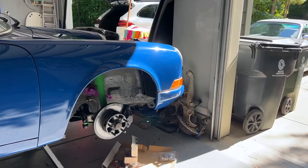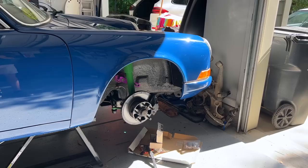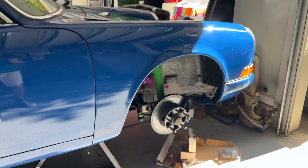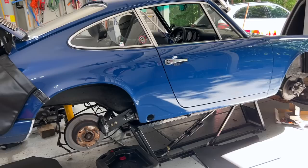It's got a small fan on it, which will help — though it doesn't have maybe the best airflow because the battery box is in the way. But that cooler with a fan, plus we're going to be running the elephant finned oil lines, and the fact that it still has an engine mounted oil cooler — it'll be overkill with plenty of cooling. We won't have to worry about the oil getting too hot. Magnesium case engines don't like to be hot; they start leaking like sieves, and this will help prevent that.